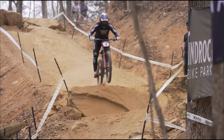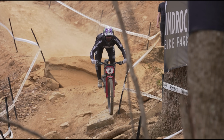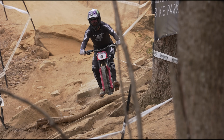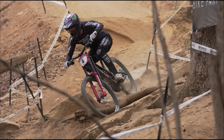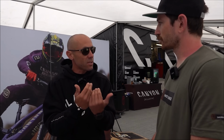Well, the thing is, a lot of people think that in terms of anti-rise, you want to optimize the traction in the pure functioning of the suspension, which is the case on most automotive or moto style. It's what you're looking for to keep the wheel on the ground in braking, which I think completely isolates an issue in our sport, where the actual mass is the body of the athlete a lot more than the machine itself. Yep. And the off balance that anti-rise creates in terms of braking is actually generating more issues than pure suspension functioning. So that's why, in my preference, I decided to go with very high numbers to be able to keep the stability of the chassis, which also goes behind the choices that we have made through the kinematic and the axle wheel path that we have on the Sender 3.